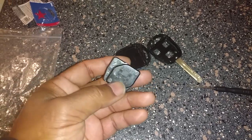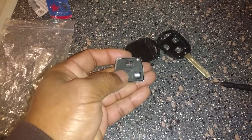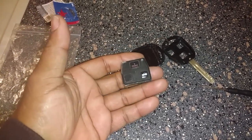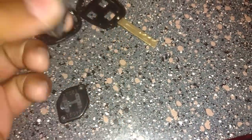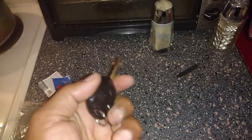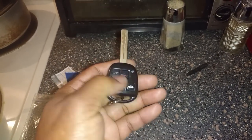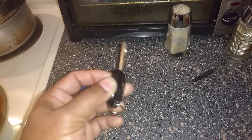You can see there it's got a little clip holding it down. Work that and make sure it's all the way in, then put this back on and put the screws in. After you've got those two screws in, you can test the unit — push a button and you'll see the red light light up. That lets you know it is working. Go ahead and finish putting it together, putting it back in the remote so the buttons are lined up. Close that up, snap it, screw it, and we'll be done. There you have it — it's all back together and still works.